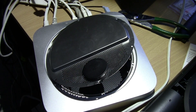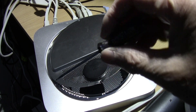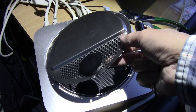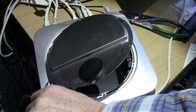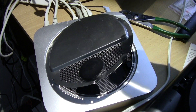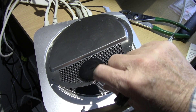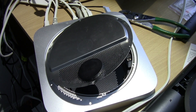I turned counterclockwise and those three screws came out okay. Then I tried using my T6 screwdriver to unscrew the rest of the three T6 screws, but those didn't come out. One is still remaining here attached to the lid. This is more like a tin can, and this black thing is a Wi-Fi antenna with a wire. Since that wasn't working, I just pried it open — I just used a screwdriver to pry it and pop it open, making the hole a little bigger until it just popped open.